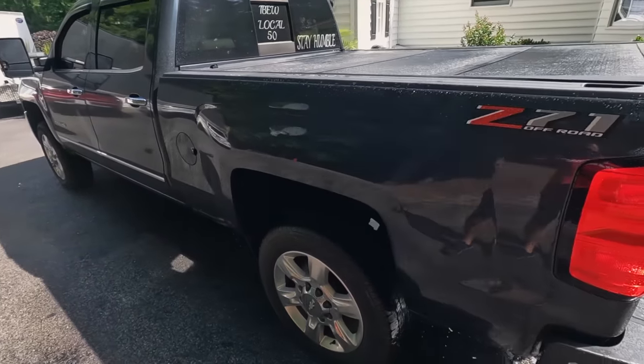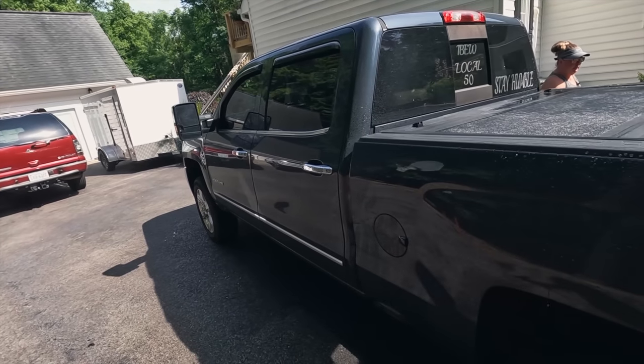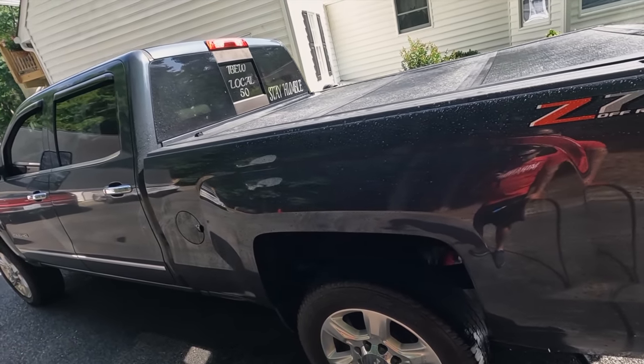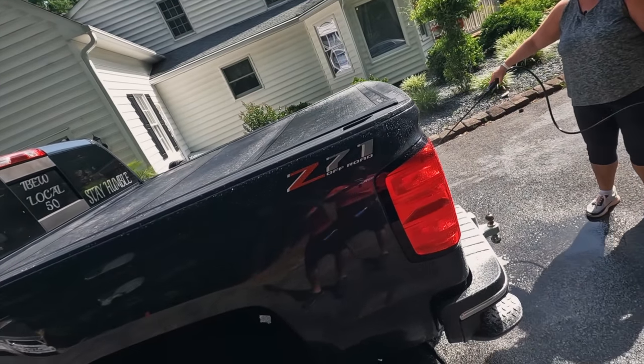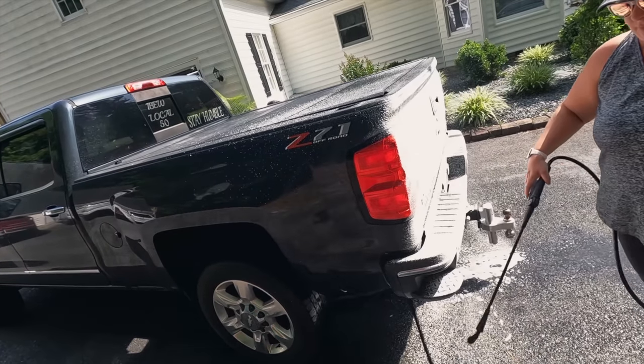Now you can choose to either pre-rinse or just use that solution right on the paint. However, if you are working in full sun and it is hot out, rinse the paint first. That's what cools it down. Don't worry about diluting the pre-wash on the paint because that is so negligible. It really doesn't make that big of a difference.